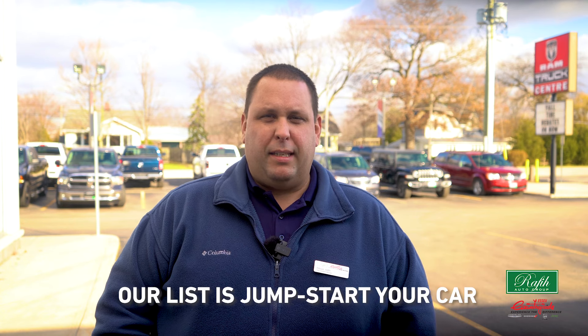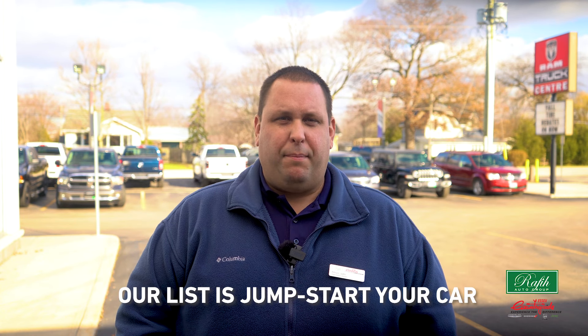The seventh on your list is to jump start your vehicle. When attempting to jump start your vehicle, the most important thing is to make sure you do not mix up the lead ends. A positive must connect to a positive and a negative to a negative — if you switch them around, bad things can happen. A helpful way to remember this is that red is associated with positive and black is with negative.